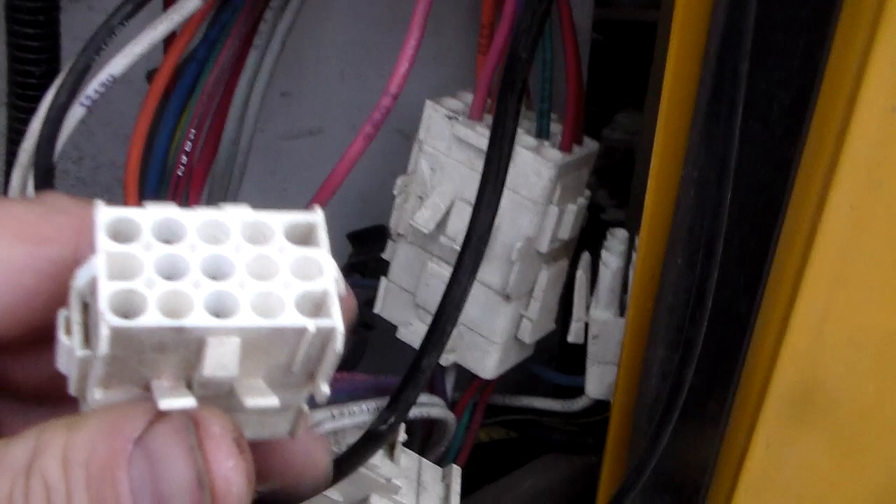I figured we'd start with the flashers on the back of the school bus. I disconnected these wires and then started tracing them through here — this big cable — and you'd get to these connectors, these shrink-wrap things. I would cut those out carefully with an exacto knife so I didn't cut the wires, and just kept tracing them all the way through. Things started getting tricky in here with this conglomeration of wires. They would drop down through there. Here we are at the electrical panel — I did disconnect my battery so I didn't have to worry about shorting. I traced the wires down and found the wiring harness where it was connected, and labeled it right there.